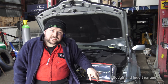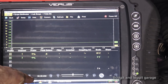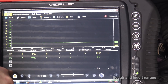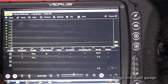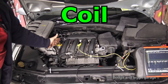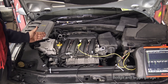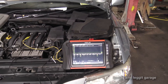Channel two is set to two volts and a two-second time base. I've set the number three coil to 20 volts — you'll see why in a second. Channel one is AC coupled with peak detect. I've back-probed on the number three injector. It's important to know your injector numbering — on this car the timing belt side is number one, so we have one, two, three, four. Our firing order is one, three, four, two. With those few simple things it's really easy to figure out the scope.